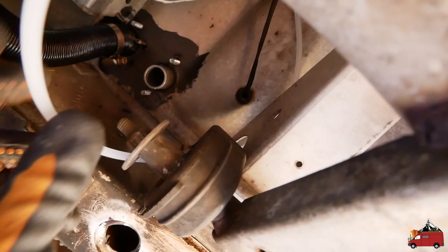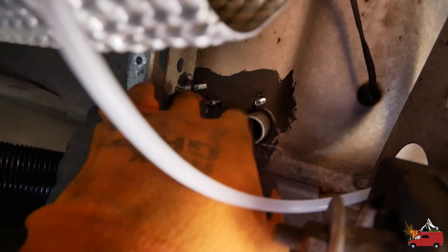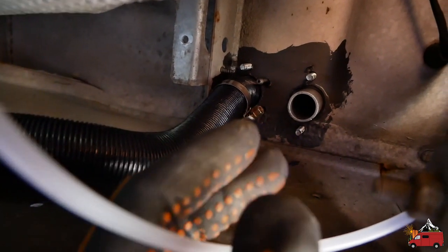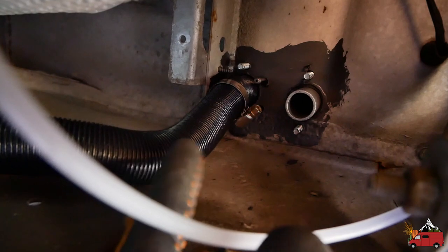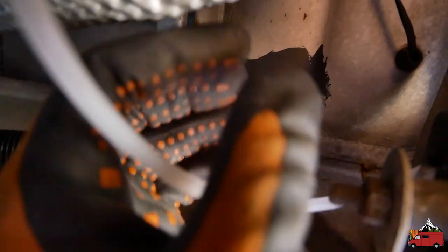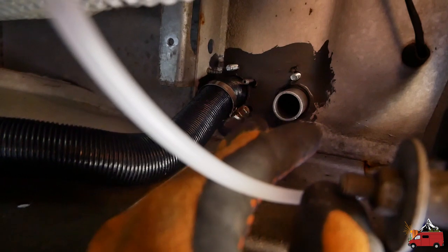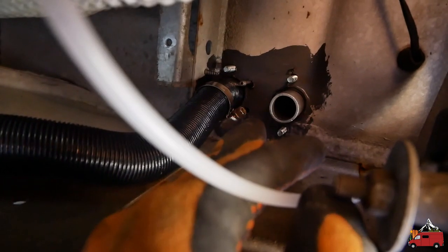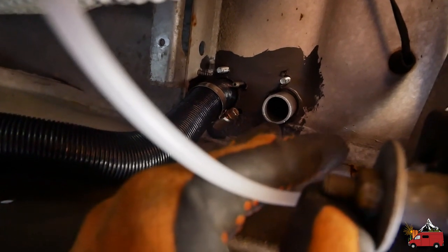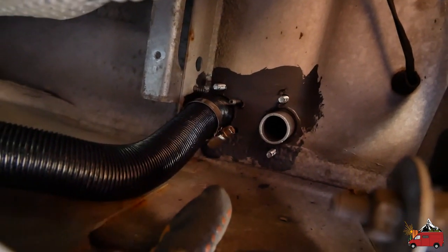I've run the wiring down and pulled it through this little hole, getting it away from the close point of the exhaust — it's still near the exhaust but not as close — and it goes right up here to the heater. I'm working in a really small space. I threw the heater in here and literally the hole for the hose is against this beam. What I ended up doing was running the air intake hose through the hole first, connecting it to the heater, then pushing the heater down through. I'm going to clamp that first because there's so little space, then connect the fuel line, exhaust, and four mounting bolts.